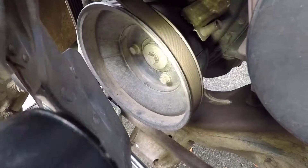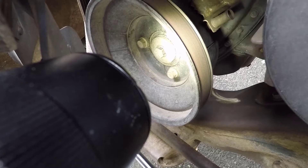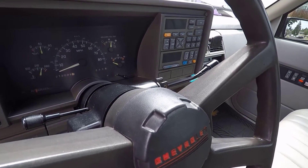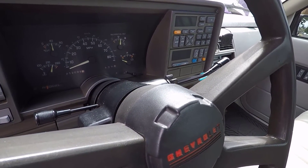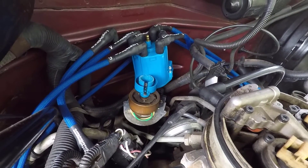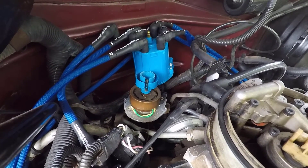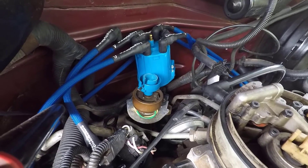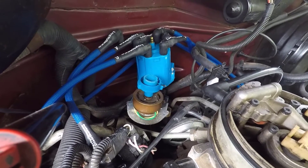I need to get a wrench on that pulley so I can turn this over and see where the engine's at. Also — I forgot to mention — you're going to need to put your truck in neutral so you can actually turn the engine over by hand, disengaging it from the transmission. Now we're going to go ahead and turn this engine over by hand. We can watch the rotor and figure out where top dead center is because we can also hear this whistle that's already hooked up.